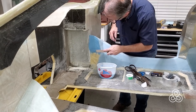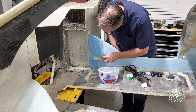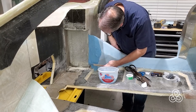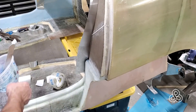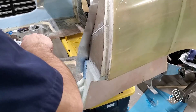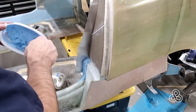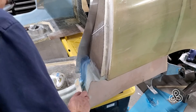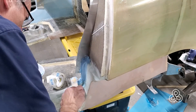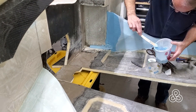I've got some exposed foam, and I've mixed up some slurry that we're going to use to fix our door jambs and create some shape. While I have the slurry mixed up, I'll cover up that foam we're going back to another day. I don't want the slurry to stick to the aluminum, so I'm putting Mylar tape on it — the slurry won't stick to Mylar. Then I'll thicken up the slurry a bit more so I can create some shape with it, building out a little bump to create a tighter seal.